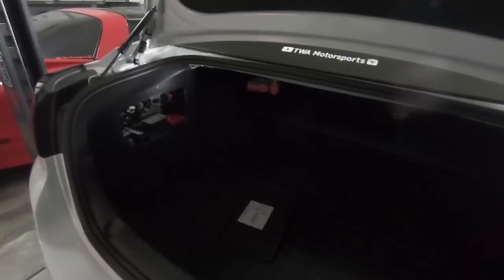The very first place we have to start, guys, is we need to get the power turned off on this thing. The battery on these are in the trunk. I did notice when I lifted this up, I thought it was underneath here. I didn't even look over there, but this is a spare tire car, so I guess that's kind of rare in these. I don't really know, but 10 millimeters is all it takes to take loose the negative side of the battery, and that's what we are going to do. And then we're going to lift this thing up, and I think we're going to start on the exhaust. Like I said, if I'm going to start from the back and go forward, I think that's where we're going to start.